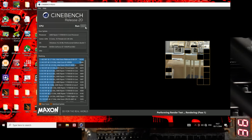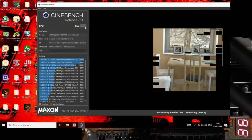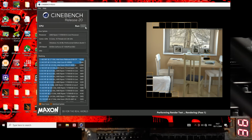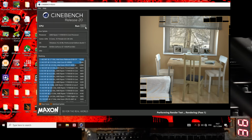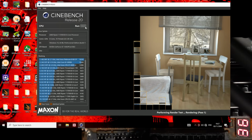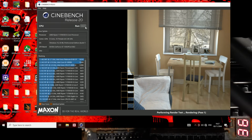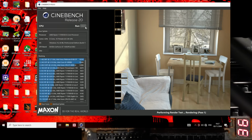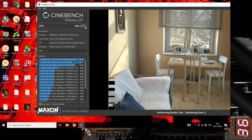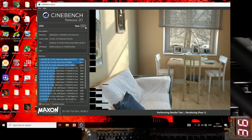You do have the scaler, but the scaler doesn't really do anything for performance. It changes the voltage behavior a bit. So yeah, this thing is really locked down. And I think the only way to get substantial overclocks on one of these would be an X470 motherboard with an external clock gen, and also a volt mod so that you can bypass the core voltage restrictions that are enforced in the BIOS. There's a core voltage limit. The thermal limit exists. The CPU is packed with safety features. Just make a frequency offset function.